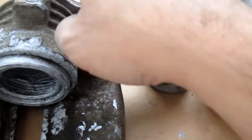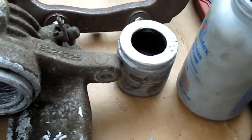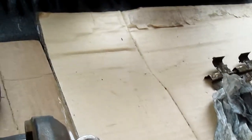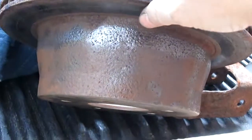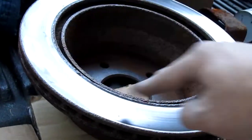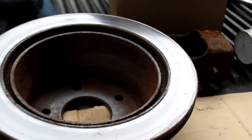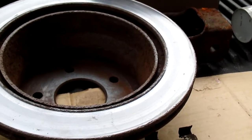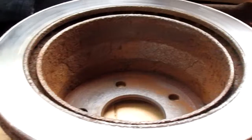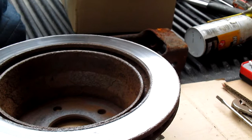If you ever take your brake apart, don't just change the brake — do everything. Clean everything up. Look how nice that is now — I brushed it all off with the grinding wheel. And then I'm gonna anti-seize this section and the other section so it won't adhere at all. I'm gonna anti-seize everything, because if something happens it'll come right off.